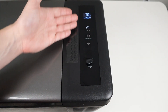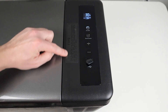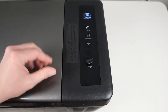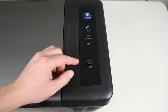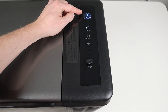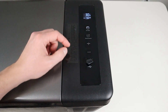Let's talk about the control panel for this fridge. It's a really nice touch screen, and I'll go into some of the features it offers. The first thing you'll notice is a sticker that says if the fridge has been inverted, you want to wait 12 hours before turning on the compressor. At the bottom there's a USB charging port for your phone, which is great to have built in. The display shows the current temperature, the voltage — which is awesome for a fridge like this to have a voltmeter — and it also shows your battery protection levels and compressor settings.